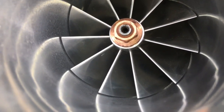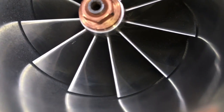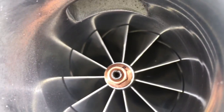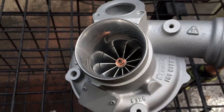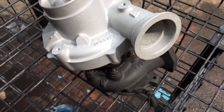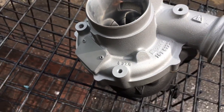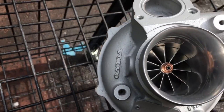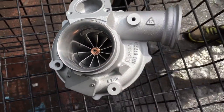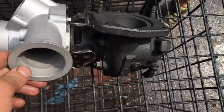On all other models of turbos, usually you need a 360-degree thrust collar and spacer to go along with the thrust bearing, but for this turbo, the 270-degree uses the same thrust collar and spacer as the 360-degree bearing kit. So I just need to change out the bearing, which is a very unusual thing, as all the other turbos are not designed like that with a 270-degree thrust bearing.